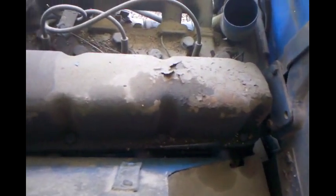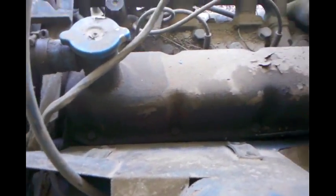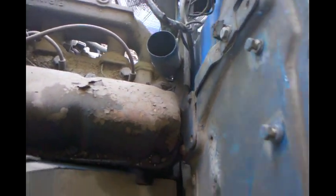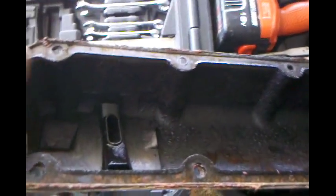As you can pretty well see the valve cover is pretty much right there. I got a bit of trash and a bit of oil leaking. I'm going to go ahead and pull that valve cover — actually, before I pull it I'm gonna spray it down with some brake cleaner and a little bit of compressed air, try to clean it up so I'm not getting trash and everything down in the oil. Alright guys, here's the valve cover — got it off, and this gasket has seen better days.